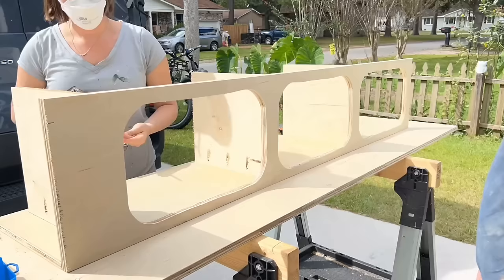The next day I had to start building the side doors — something I'd been procrastinating because I had no idea how to do it. After some research I realized not many camper builders make their own doors because they not only need to open and close, they also can't leak in rain and need to look good. I also decided to add windows, just to complicate things further. Despite all the odds I built the doors anyway, cut the hole for the door lock, measured and cut grooves for the stainless steel hinges, and installed three hinges on each door for maximum durability.